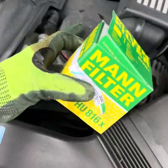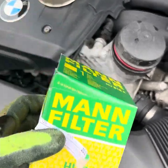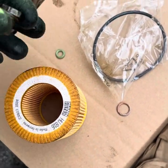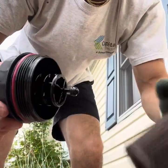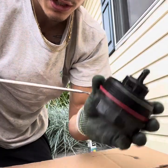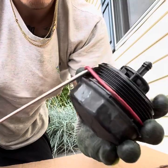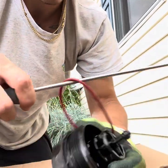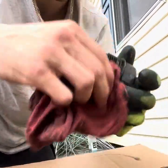While that's draining, we're gonna take this out and replace it with the filter. Highly recommend Mann filter for any BMW — don't get anything cheap from AutoZone or anywhere else, get Mann filter. Your Mann filter is going to come with these four things: the filter obviously, and then these rings. We're gonna take this old one off, trash it. Take out that ring — it's usually not red — make sure you know where it goes because I've had problems before putting it in the wrong spot. Take that out and wipe it down, keep it clean.